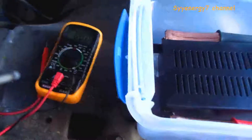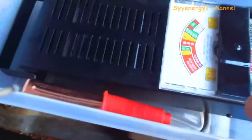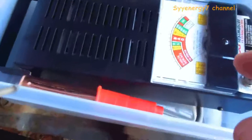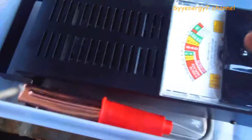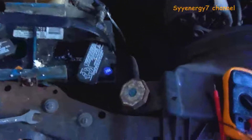I used the load tester on it and it was going all the way down. I load-tested this battery and I check it every six months or so. Out of the car it was always good — way up in the green, really good. So I'm thinking there's a really slight parasitic draw, but if I let this car sit for a week, no problem, because you're talking one-hundredth of an amp.